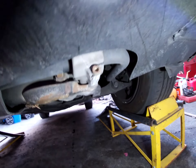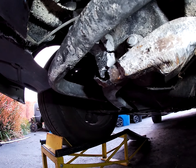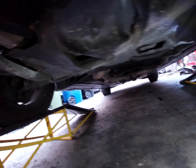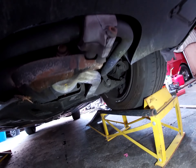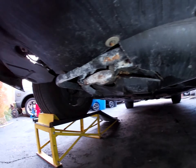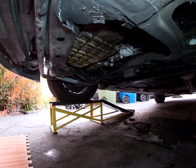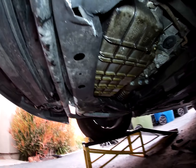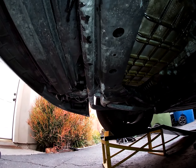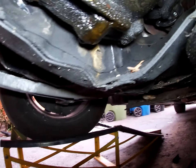So see — there's the bracket for the sway bar right there, and over here — nothing, you can see the crack. Sorry for the flickering light. Wow, that came close to the oil pan. What else is hit under here? That's about it. I'm going to have to take off this shield up here — I think that's 10 or 8 millimeters. With the splash shield off, yeah, you can see all the damage now. See right there — that's bent. And the subframe — you can tell it goes all wonky — and there it is, bent also. Bent right there. So it crushed in good spots, bent back there.